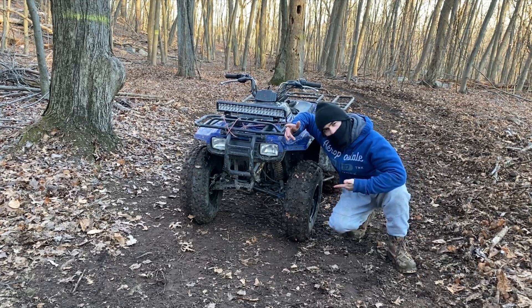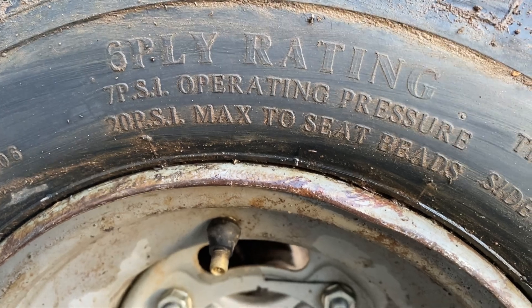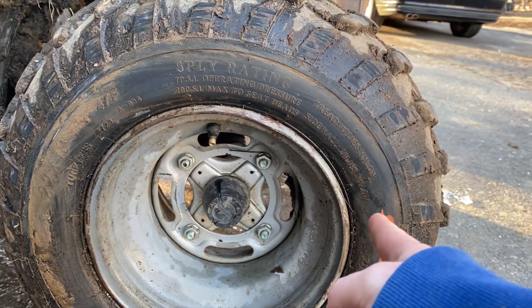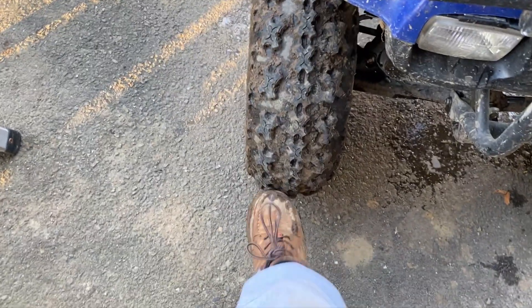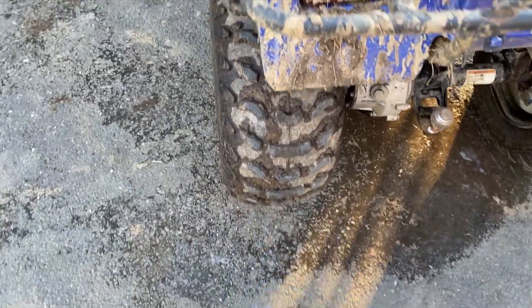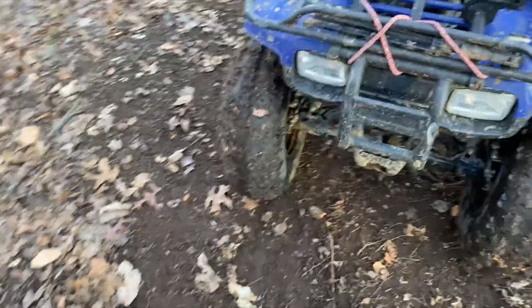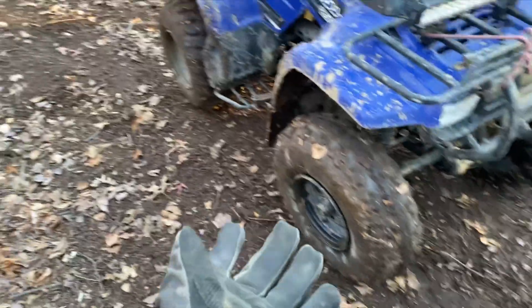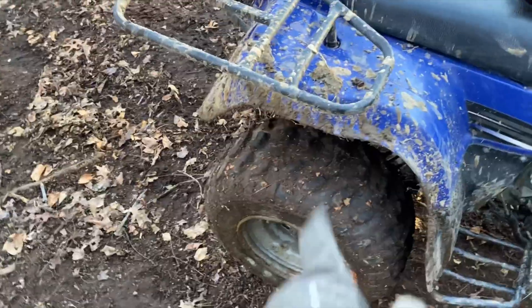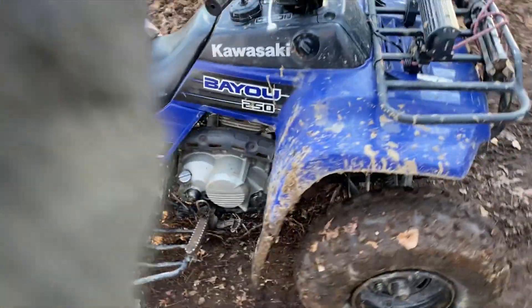Super low or super high tire pressure — what has more grip? We're testing 35 PSI in the front (max recommended is 32) and 20 PSI in the rear (just enough to seat the bead). The tires at 35 are rock solid. We're in the woods on a little rally course we made, running just about max recommended pressure for all of them.